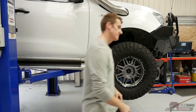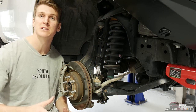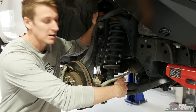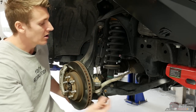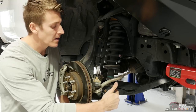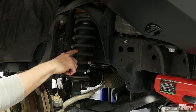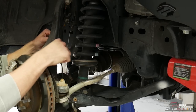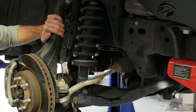We're going to start on the front suspension first — remove both left and right wheels. Let me break down the front end: up top is your upper control arm and lower control arm. There's the steering knuckle connected by the ball joint to the upper control arm, the tie rod controlling steering left to right, the sway bar with its linkage, and the main strut incorporating the shock and spring bolted top and bottom. Tucked behind the strut is your CV, plus the wheel speed sensor line and brake line.